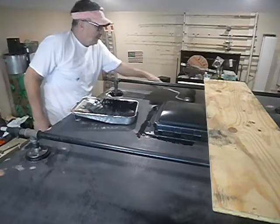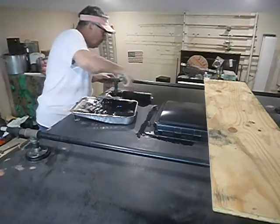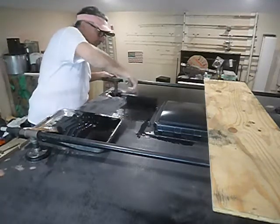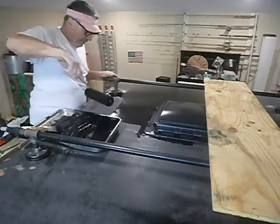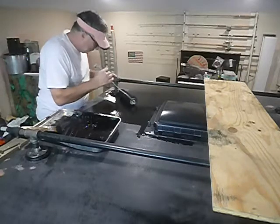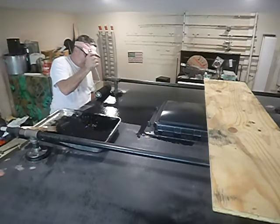At least this way, let's say you're out on a camp out and a tree branch falls on your roof and breaks a hole in it. You could stop off at your local automotive store and get a can of Bondo, fill that in and sand it out and make it look proper. Then get a little disposable roller at one of the big box stores — Lowe's or Home Depot. You'll know the code of your paint — let's say it's Sherwin-Williams, whatever number that is, 1096 or something. Whatever your paint code is, get some of that and roll it on and you're good to go again.